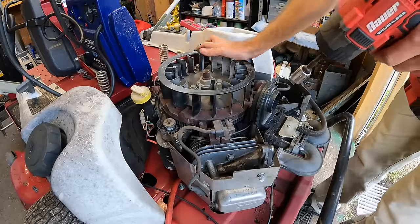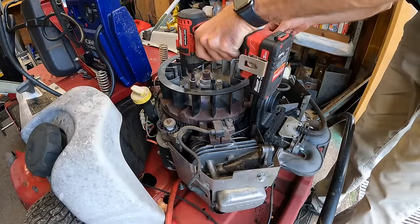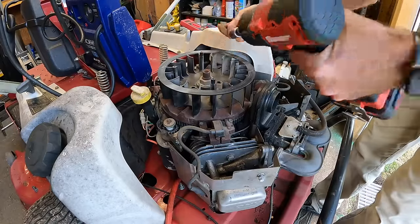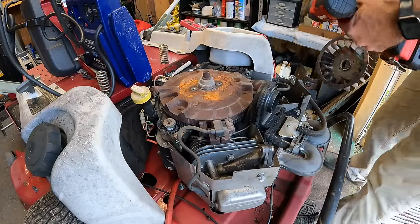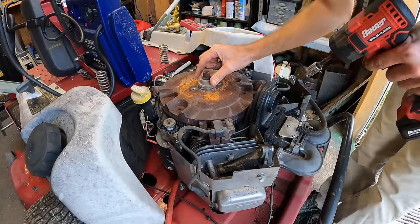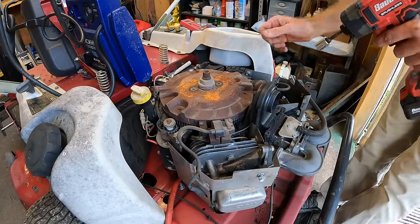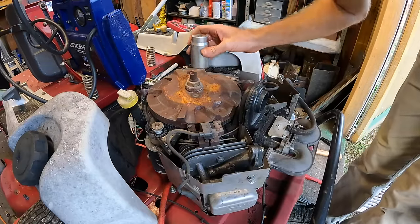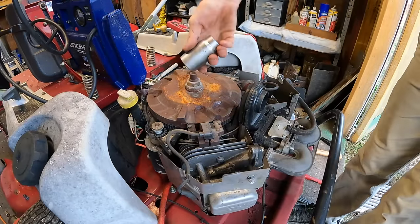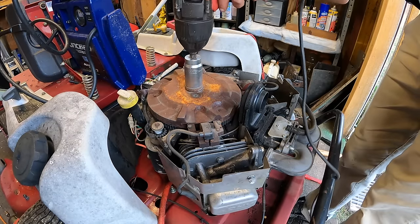We've gotta pull the fan off the top first. Should just be these two half inches. I don't even know if I have a socket that's big enough for this flywheel bolt. But let me see what I got here. And then at least we are threaded though. I've got a puller that we can use to pull this up. So I did in fact have a socket that fits. Don't think it's exact, but this is a 32 millimeter. Hopefully this is gonna knock it.